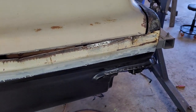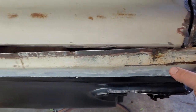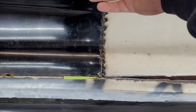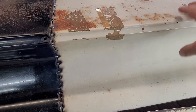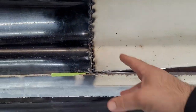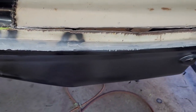The car was wrecked — you can tell by all the little dolly work that was back here. All this right under here was under stress. So when we cut it, the fin jumped up big time. And then when we got down here, this bowed out. All this metal was under stress from whenever it was wrecked. We're going to have to figure something out.